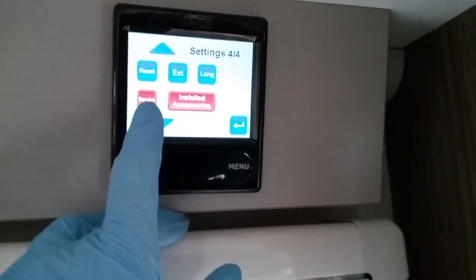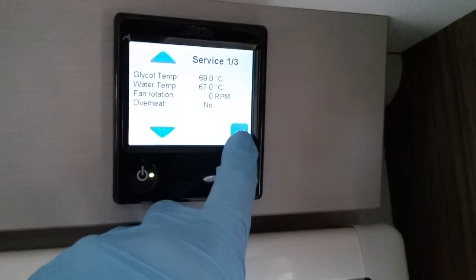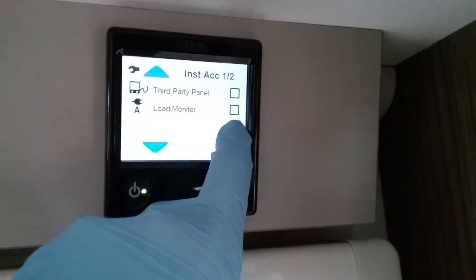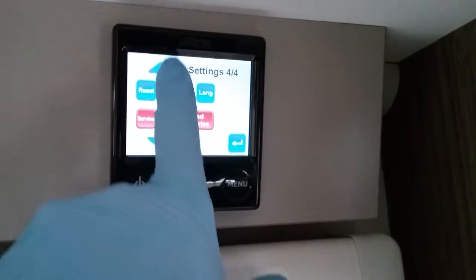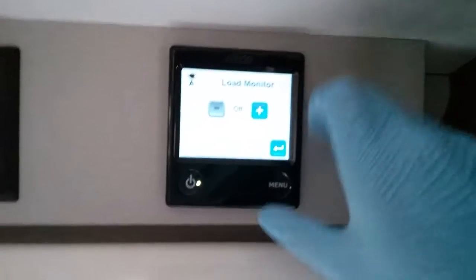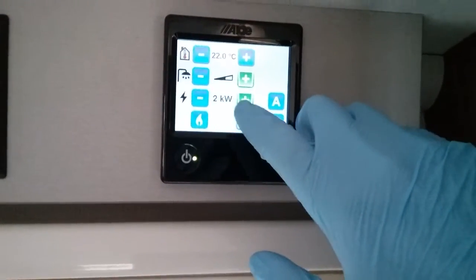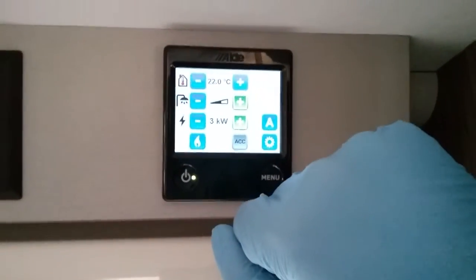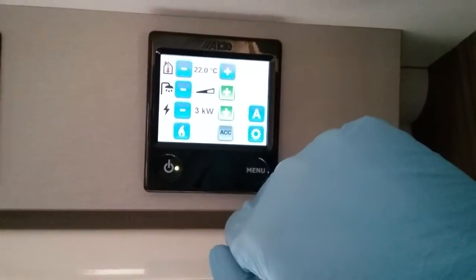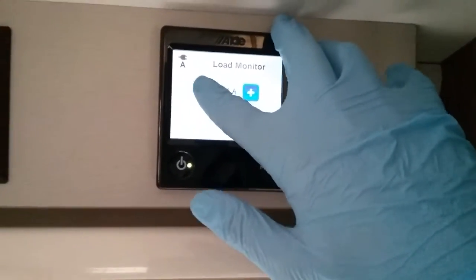Language and service menu — more for the workshop, but you can see what everything is up to. At the moment the ethylene glycol for the radiators is at 69 degrees and the water temperature is currently 67 degrees. In installed accessories, the useful one is the load monitor. If you arrive on a site and know the amperage — say it's a 10 amp site — you can enter it into the load monitor, and it will not allow you to pull more than that. If you were trying to pull 3 kilowatts from cold on a 10 amp site you would definitely trip. The maximum you would find on a site is 16 amps.